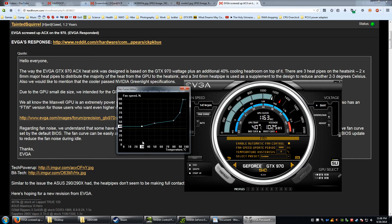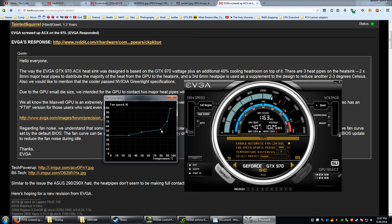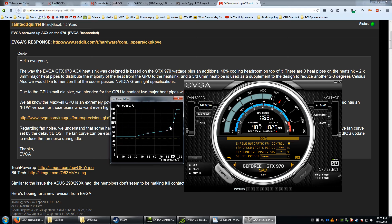Up to 30 degrees Celsius it stays at 40% fan speed. Then at 50 degrees it bumps up to 47% fan speed. The next notch is at 80 degrees — it goes up to 53% fan. 80 degrees here is the target temperature, and then I've got it set so that if it gets up to 90 degrees there's a really steep curve — at 90 degrees it kicks the fan up to 70%. The last step I have is at 95 degrees, where it will jack the fan up to 99% — that will be loud, but it's intentional because it shouldn't get that hot. That's a safety measure.